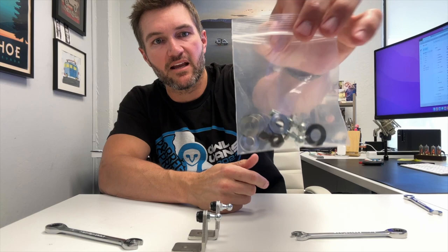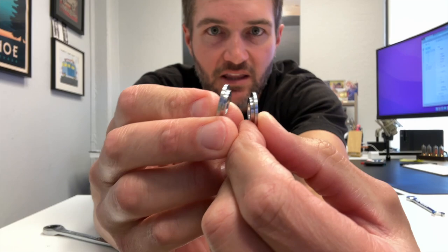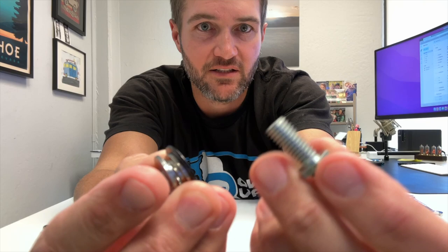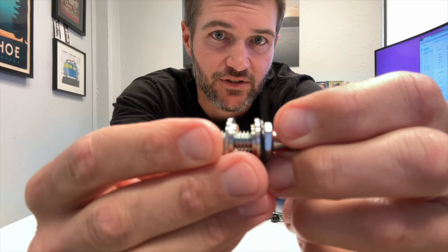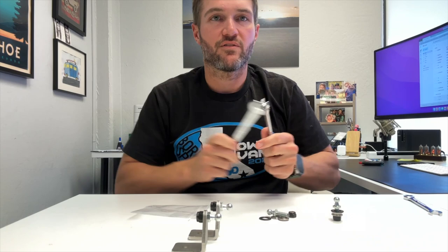Then you're going to have this bag of hardware. There are these little machined aluminum washers — these are going to sandwich the Mercedes part. The way you build this up to put it on the van is: black washer, machined aluminum washer with the step down facing up, then put it through the van, and the other aluminum washer caps it off. You should also have a nylock nut on the backside. Then you tighten all that down. You've got your tools and tightened down the bases — let's hop outside and put it on the van.